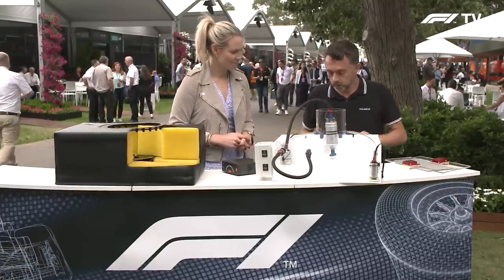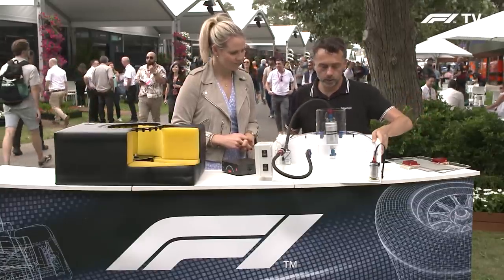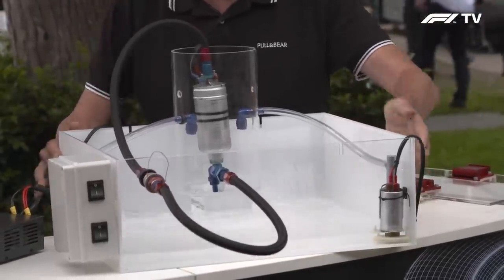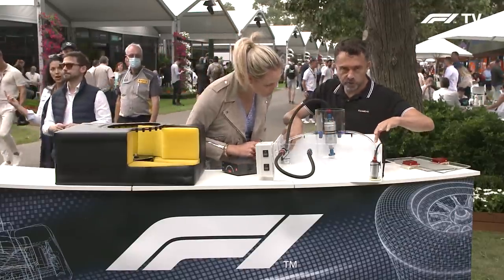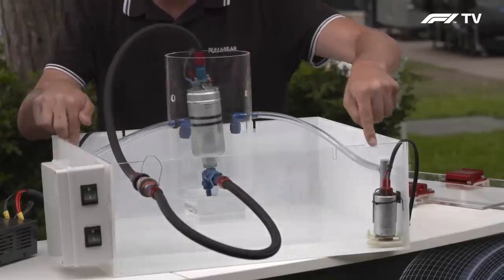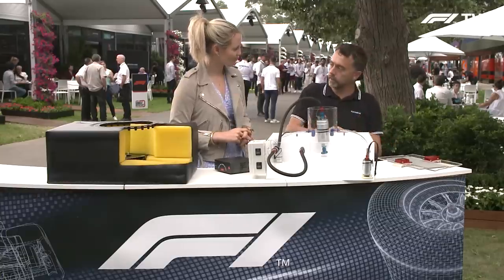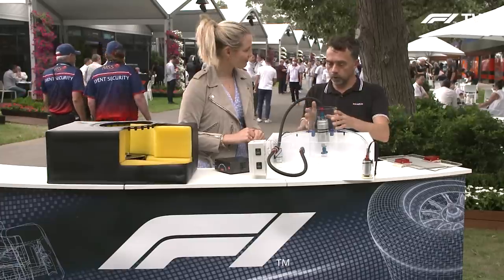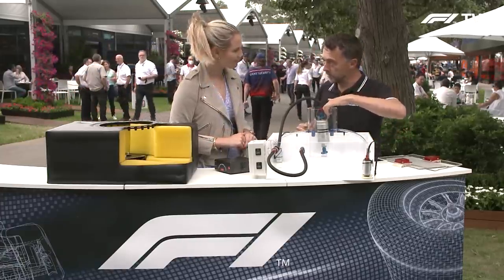How do they do it? A fuel tank has a big area, so maybe when you go into a corner the liquid moves to one side. When you go into another corner or brake, it moves to the front. So what they do is place very small, very low pressure fuel pumps on each corner — some teams have four, some others three, some others two — capable of taking the fuel from whichever side it's moved to, front and rear. Then they pump the fuel into the collector, which is normally between one and two litres. There, we have a higher pressure fuel pump.